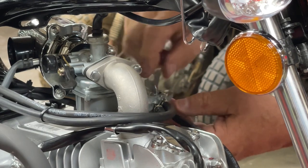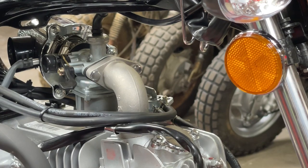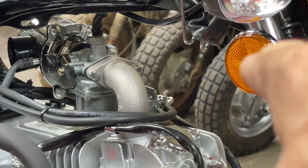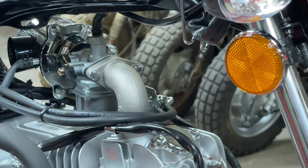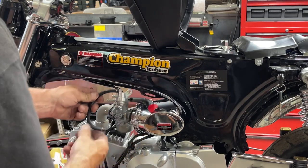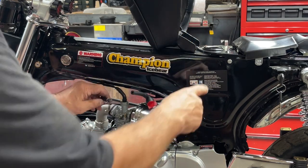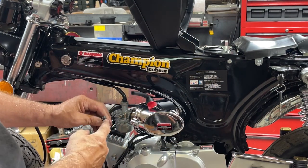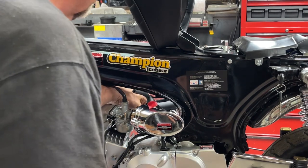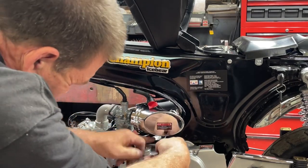I would like to figure out which one of these is the on and the reserve. So anyway, I'm going to shut you off. I'm going to plug off the on fuel line and run the reserve line straight to the carburetor. Let's see how that does. All right, so I have removed the petcock and the line to the carburetor for what I believe is the on setting for the tank. I have just used a little piece of quarter inch round bar and plugged that line, so that'll hopefully just fill with gas and sit there and not leak.